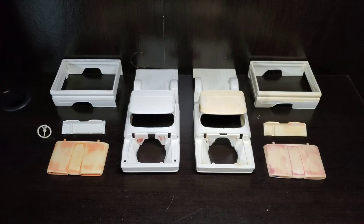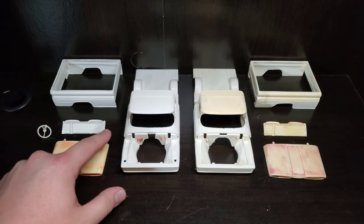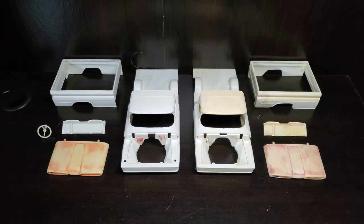These are both annuals and not the newer tooling. An easy spotter guide: the annuals are a long bed with that sweet Apache trim down the side; the newer tooling is a smooth-side short bed. There are plenty of other differences, but that's a quick and easy spotter's guide. Both of these are essentially ready for primer — I've done all the prep and body work.